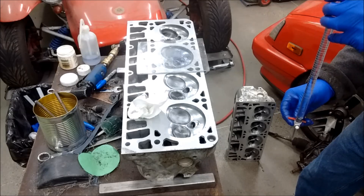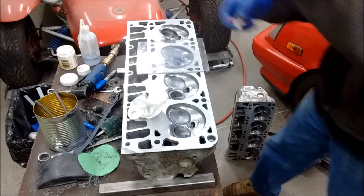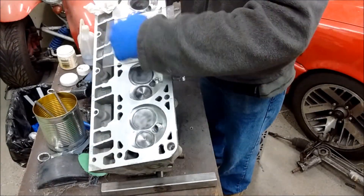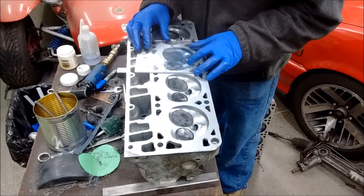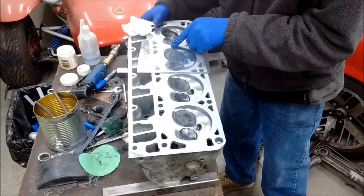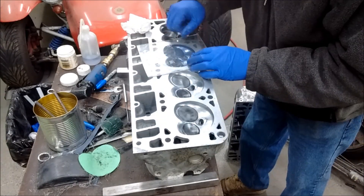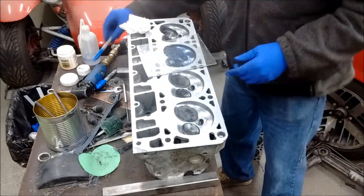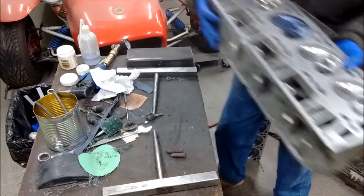May not be the best — I don't think it matters, depends how fussy you want to get. All of these combustion chambers, I had to tweak a couple. I got them within about 1% of each other, but I may muck with them a little bit more to get them a bit more precise. One head is averaging in the mid 72's, like 72 and a half. The other one is in the very low 73's.